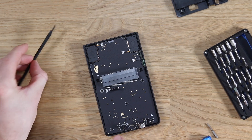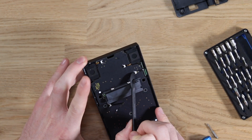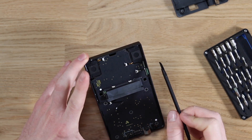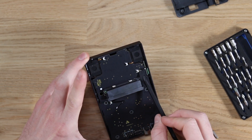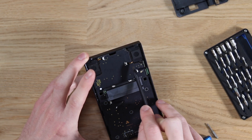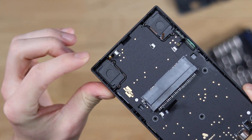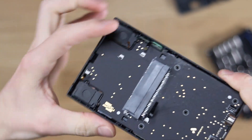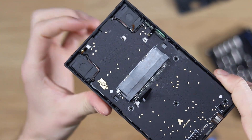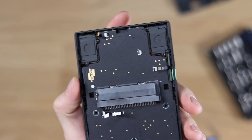This part is very simple to take out. There are three ribbon cables here — presumably one for the power button PCB — one here for the speaker, so go ahead and remove that — and then another one up here for the other speaker. They've used an individual modular design for the speakers, so in theory if they started sounding bad in the future, you could buy replacements.